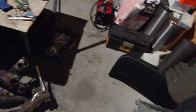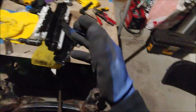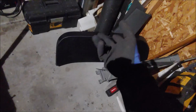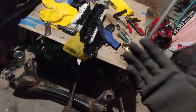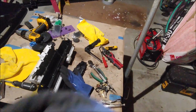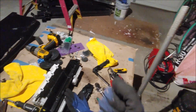And you might be thinking that, hey, most of this weight came from all these interior pieces. And that's actually false. Most of the weight came from simplifying the wiring, the dash beam, the floorboard, stuff like that. Around 40 pounds came from the wiring of the interior of the car, versus around 20 pounds from all these interior pieces, which is really good because it's not really about making the car lighter, it's more about me adding upon things. Like I've said before, me adding more reinforcements to make the car much more stable at high speed.